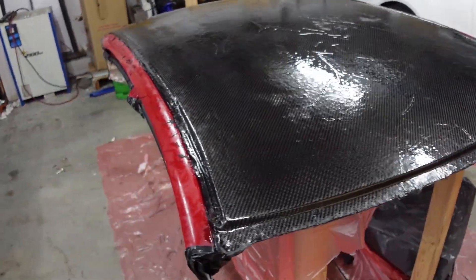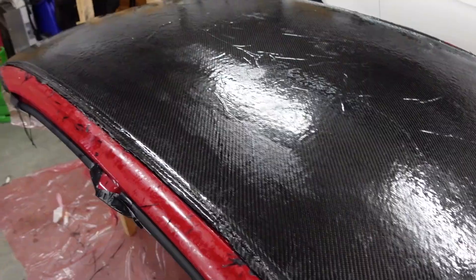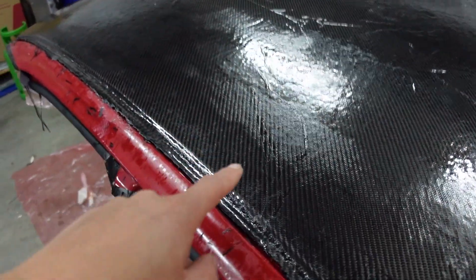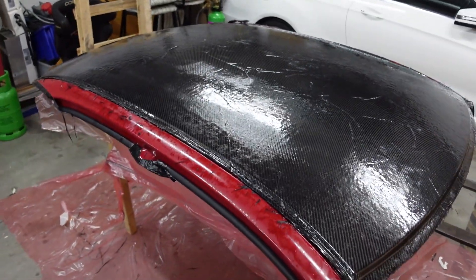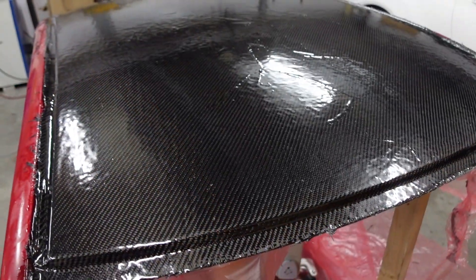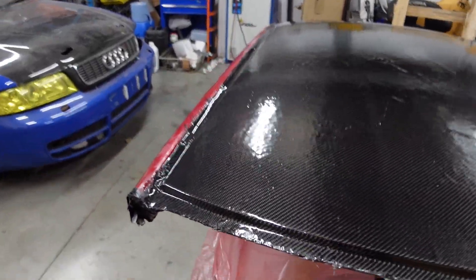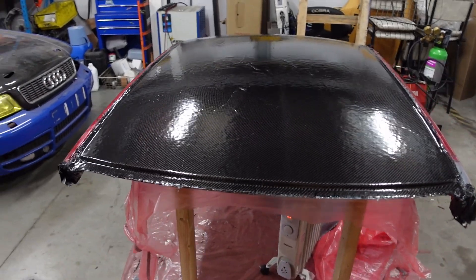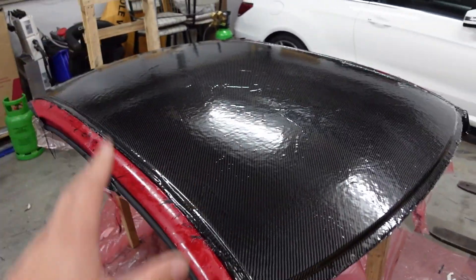This has now had an extra coat of resin over it to cure the dry spots. It's looking more carbon-like and hopefully once this is cured I'll do a second coat because some areas have soaked it up quite a lot. There are some glossy areas but the whole thing will need flattening back. Once it's all flatted back, we do the final coat to make it nice and shiny. This has now had two coats of resin and it has been completely wetted out. We still have some marks from creases in the peel ply, but that is now looking like carbon fiber. Once it completely cures, it's ready to get flatted back, trimmed to fit, and then have the UV coat on top.